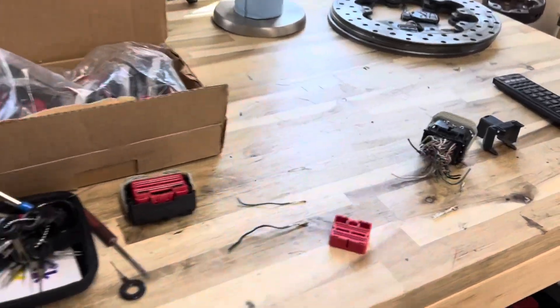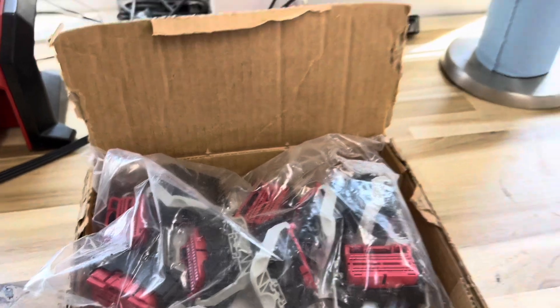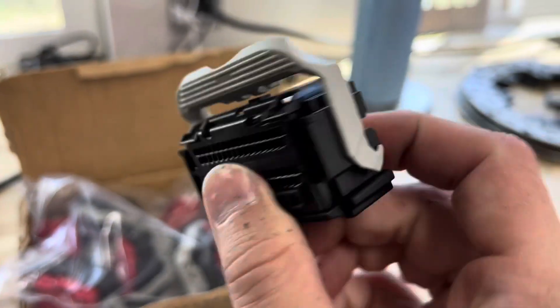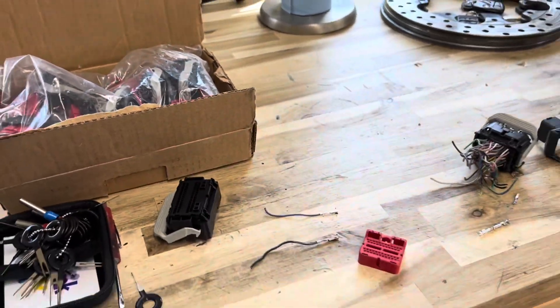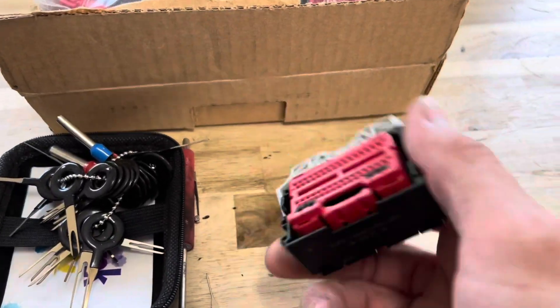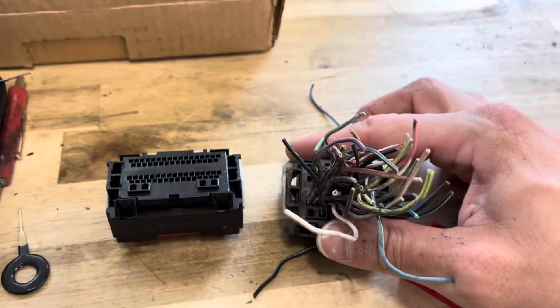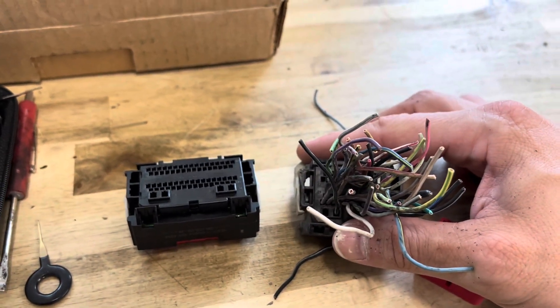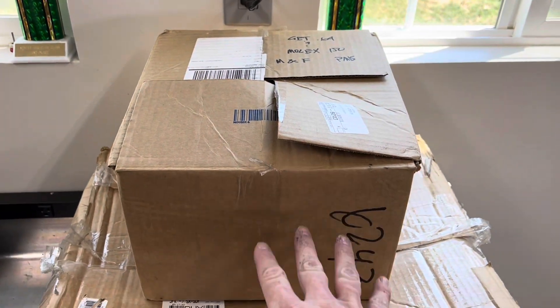This isn't the commission harness — this is actually off of my own car where I was practicing with some pins. I have the blank 70-pin connector that goes to the Coyote computer, and this is the body connector. Excuse the hands — I've been doing some Fox body work on a customer's car. The meat and potatoes of the swap is adapting that to the body harness of the early S-197. I got some pins from Molex for the plug-and-play project I mentioned.